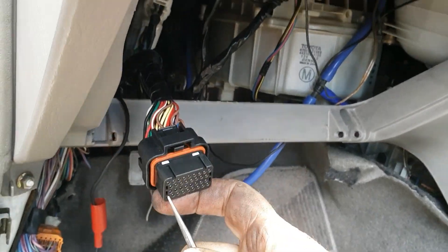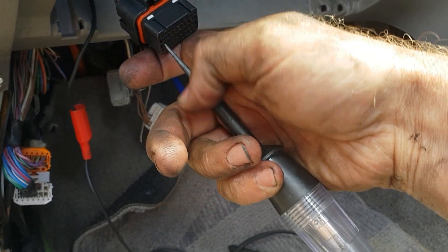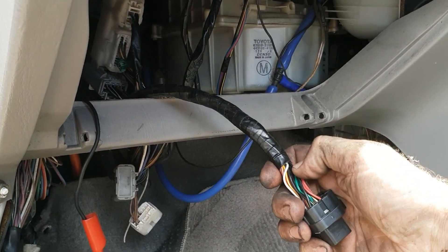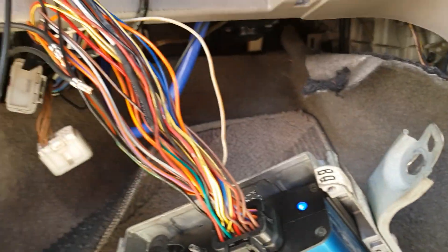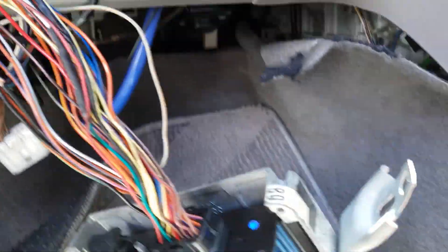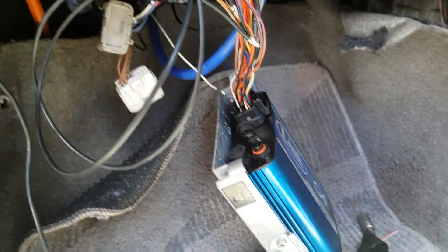Wait, I'm in the wrong place — I need to go to power. I'm using the heater relay in the back. There's the heater relay, here's the main power — there's power. Let's see if we get power when I go on these earths. Still nothing there, still nothing there. So I've solved one problem but not the second one. The easiest way at the moment is to splice into both of those and give it an earth inside the cabin and see what else we find. I quickly spliced in a couple of earth wires, ran them up under a bolt under there temporarily, and now when I plug the Link in we have a light on — that's definitely positive. Hopefully I'll get some communication with the ECU.